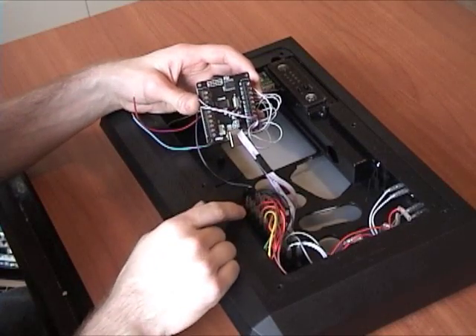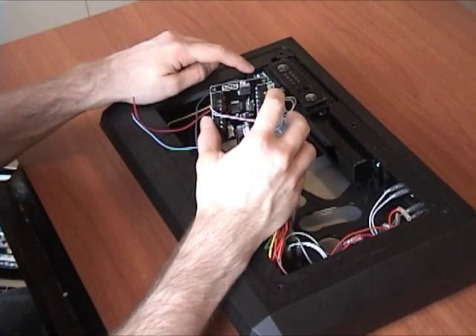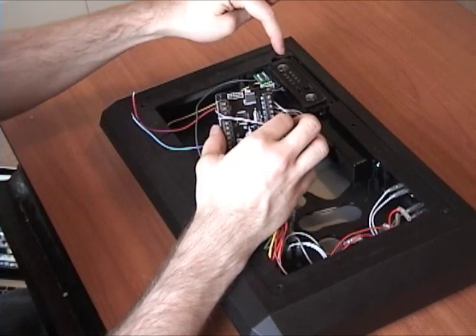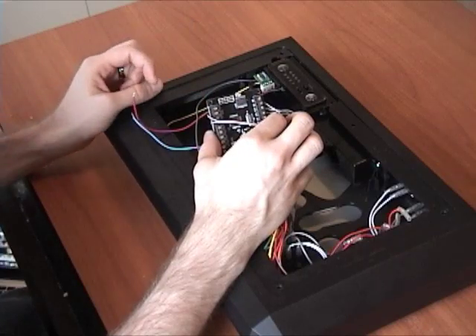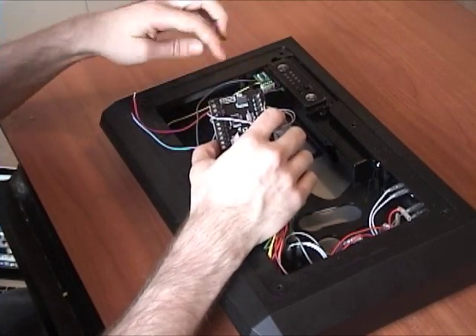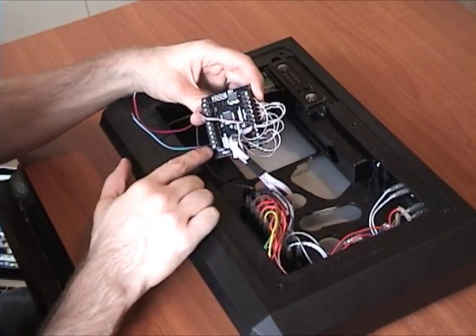That's it for the punch-down wires. That leaves the turbo and home button with the ground and USB connection, as well as the joystick. The red wire is turbo - as I nerdily mentioned, it reminds me of the turbo lights. Blue is home. Ground goes into a ground slot, and the yellow USB connection goes in the bottom where it says VCC.